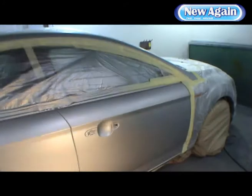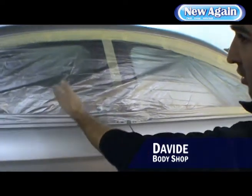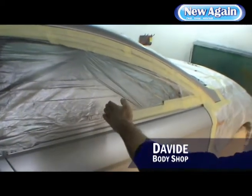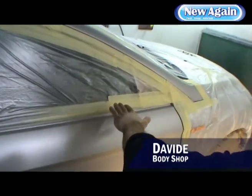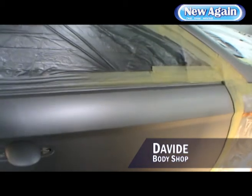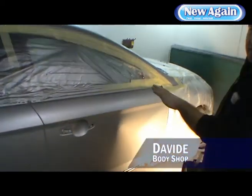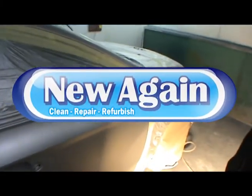You can see on the masking where the silver has gone on. You've got 100% silver here, and as it comes along it gradually fades to 75, down to about 15–25%, and you can see on the tape at the end there's no silver at all. This is how you fade it across the panel so it won't look patchy. Then you put a clear lacquer all the way on so the clear lacquer seals it and you won't see any difference between the old and new paint.